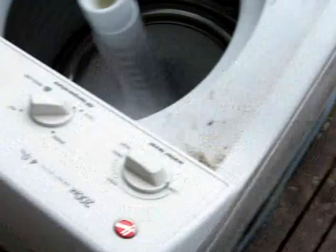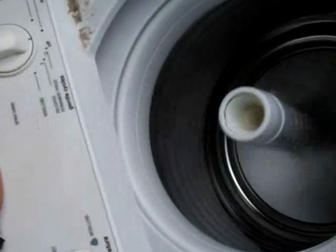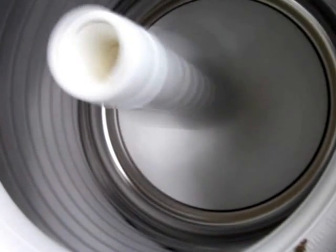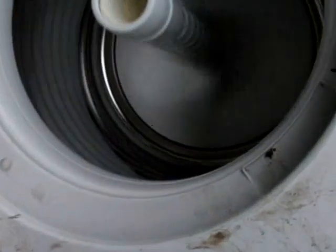These things have a lockout with that pressure switch so that if it's still got water in it, it'll just keep the pump energised and it won't actually even pull in the solenoid for the drum clutch, whatever you want to call it. Obviously, if you start spinning up the washing machine full of water, it's going to cause a lot of problems, so it seems to be doing just fine. So it slows down. We'll see what happens when it stops.